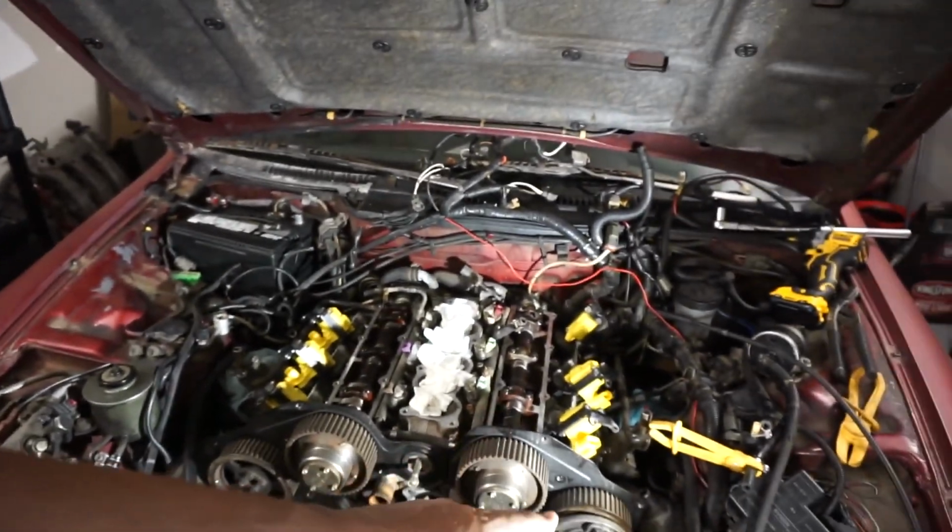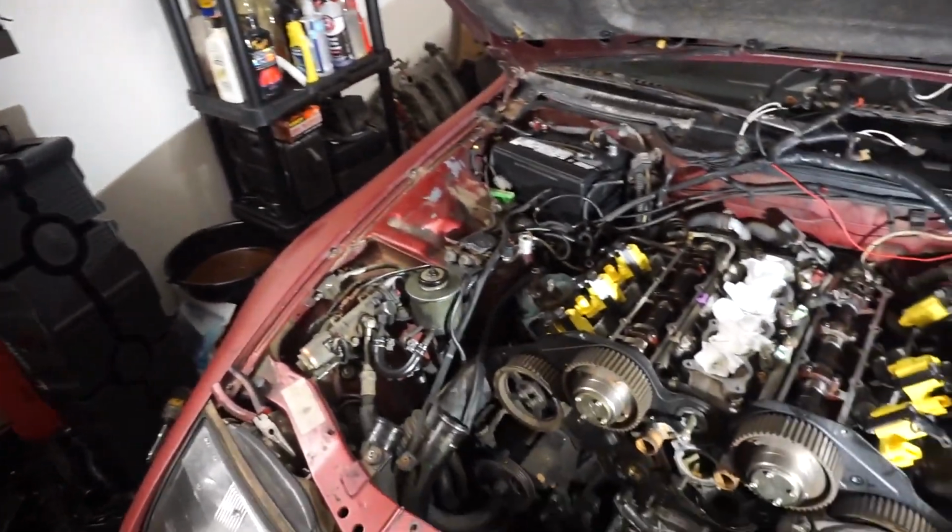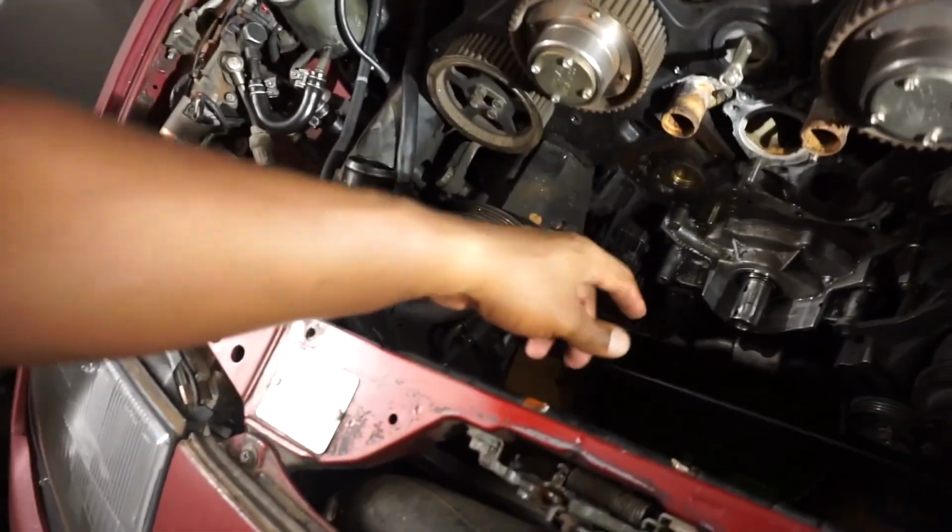All right, guys. Well, looks like got everything off. This side over here, when it comes to the valve cover, is a little bit easier. But now we're gonna go ahead and take off, you know, the cam gears, and I think that may be it. Then the next video we'll clean up the engine bay, like all that grime, and suck a bunch of the stuff out of here, you know, clean up the mating surfaces on the engine, and then I guess we'll reassemble everything and pray to the Lord that we didn't mess nothing up.